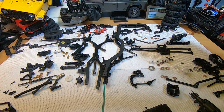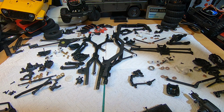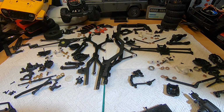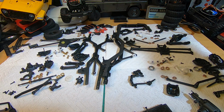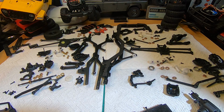And now let's come to the axles and gearings and bearings. Both do come with bushings and no ball bearings all around. Only the EazyRC models do come with 2 ball bearings in the front axle. The EazyRC models, the Patrion, Patriot and the Arizona, do use a lot more bearings than the RocHobby Katana and the CR-18 models.